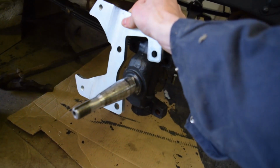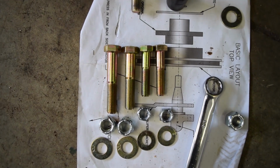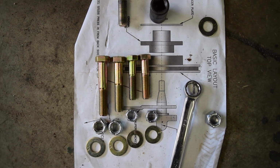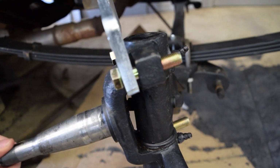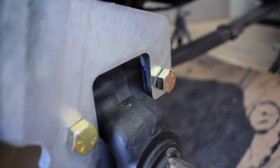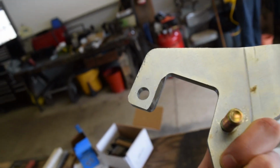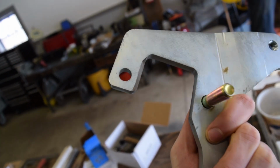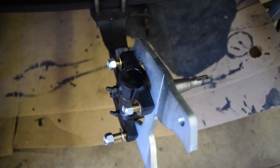First step of the kit is bolting on these caliper brackets. Make sure you have the correct one for each side. Put the 2 shortest bolts at the top, and then the very longest bolt through the bracket at the bottom. There seems to be a common issue where the passenger side bracket doesn't quite sit flush. To remedy this, I marked the area that was rubbing, and then we could ground it down to clear. It's important it fits right or everything will be out of alignment.